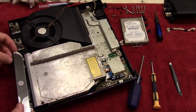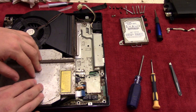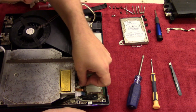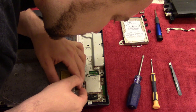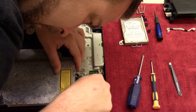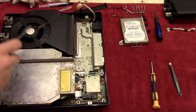So, perfect. And then we'll take this and feed it over again. So it's a little tricky because you can kind of go back and forth between these two. But once you have it properly aligned, you should then be able to have the ribbon cables out here and connect those to their corresponding connectors. Again, just push them straight in. There we go. And then screw this down, and that's going to be another black screw. So same screw as these.